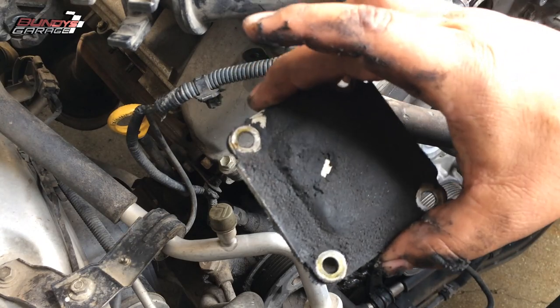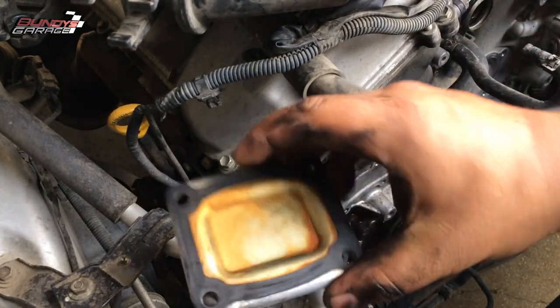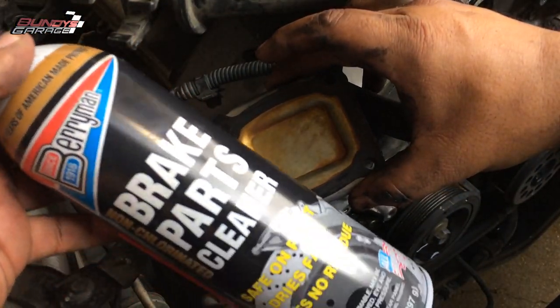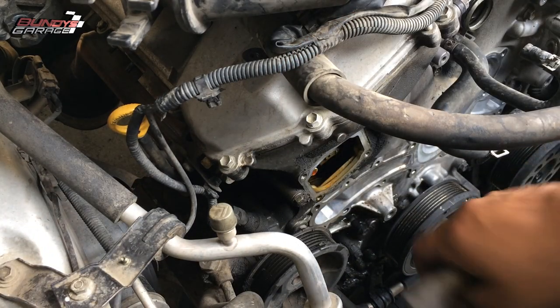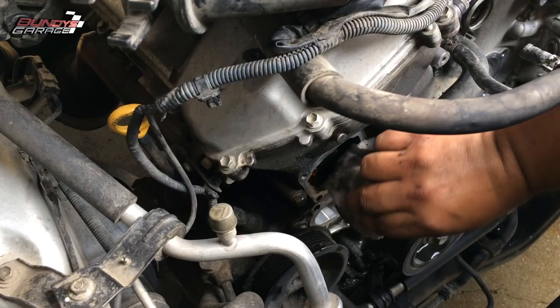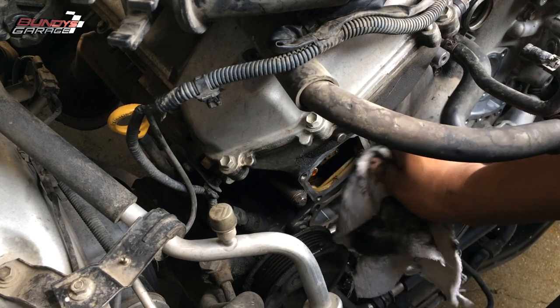The reason I'm changing this is there's oil all over the cover. You can see it right here as I flip this thing over — there's the gasket, and yeah, it's covered in oil. I was doing the water pump on this and the oil had actually gotten onto the left side of the water pump as well.